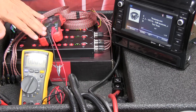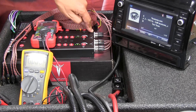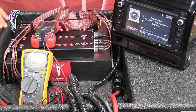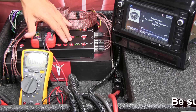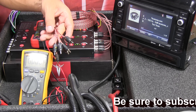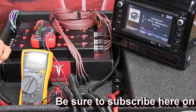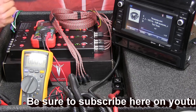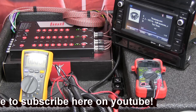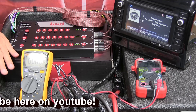The point is: use your multimeter to set the output voltage. Perform the same steps for the front, rear, and sub channels. You've now taken the cleanest signal from the head unit, fed it through the EQ system, and set the output voltage to 4 volts — ready to connect to your amplifier.